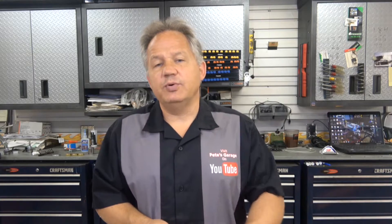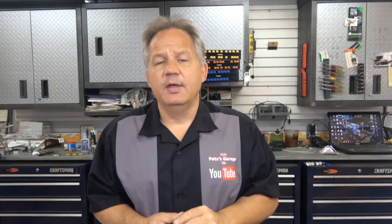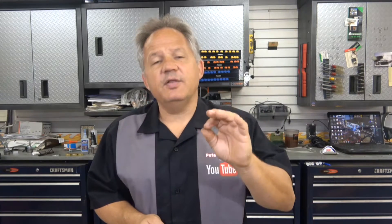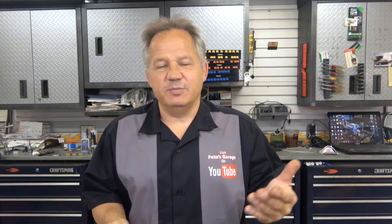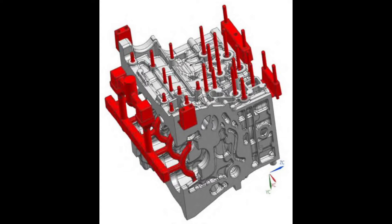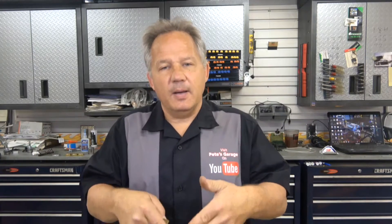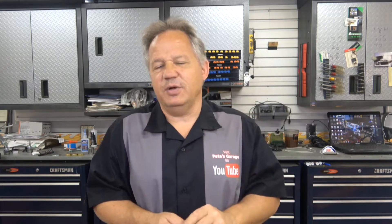The first step we're going to do is put in the core plugs. These are core plugs — they're not freeze plugs, even though they're referred to as that or the part number says freeze plugs. They're actually core plugs. They're made out of brass so they're flexible and can bend. They're part of the mold — when the cast iron is poured into the sand cast, this is where it flows to form the block. Then it's machined off later and the holes are machined so you can put these plugs in. Those passageways where the cast iron flows through are called sprues, and there are runners — that's how the molten metal gets into the sand mold and gets distributed. So these are core plugs, not really freeze plugs, but it doesn't really matter.